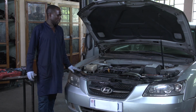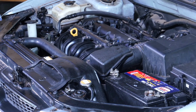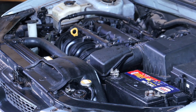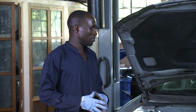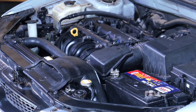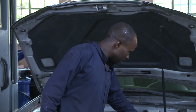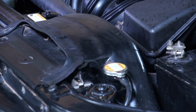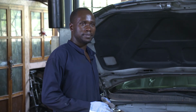You wait a bit for the pressure to build up inside there, because if the engine is running, the pump is supplying the circuit. The pressure inside is built up, and the temperature is increasing. So if the engine took some minutes to be launched, you have to check that there is no leakage in this neck. If there is no leakage, it means that the neck is well tightened. So the cooling system is now performing well.